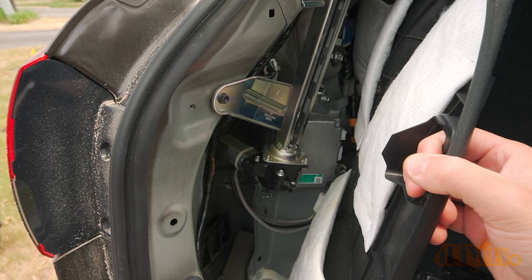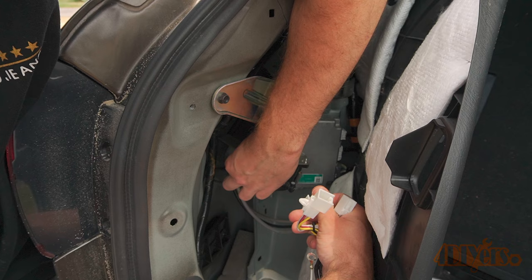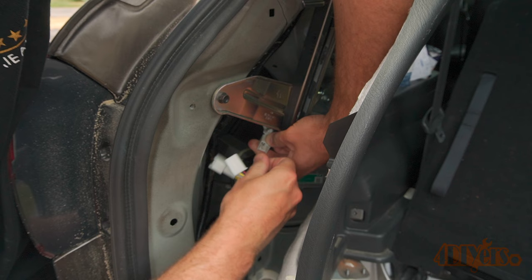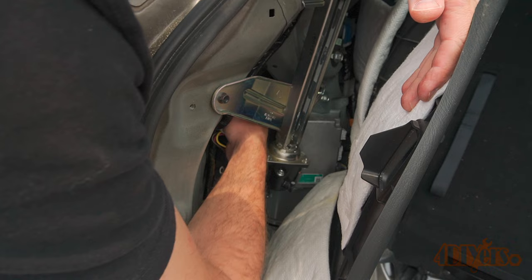It's hard to see here but there is a wiring harness behind the trunk hatch lift motor — it's a white connector. Depress the tang on the one connector and then pull it apart. Use the supplied wiring diagram with the trailer light kit. You'll see which wire colours are connected to each side of the vehicle. I plugged in both the male and female connectors into the existing vehicle harness, then clipped the one connector in the retaining hole so it stays out of the way of any moving components.